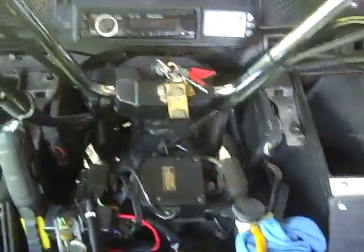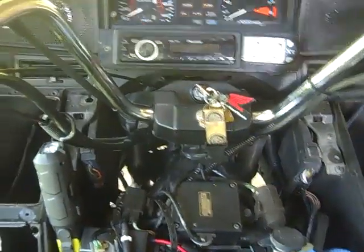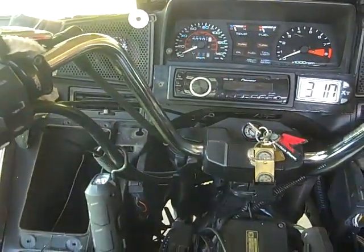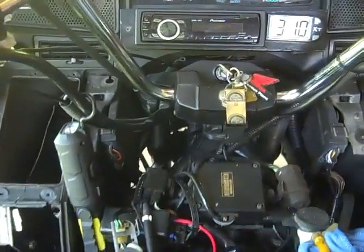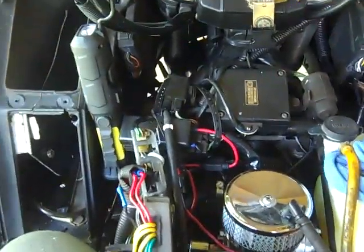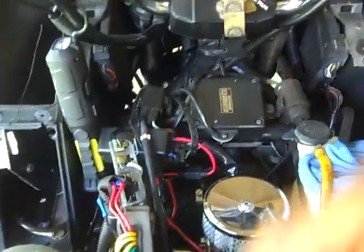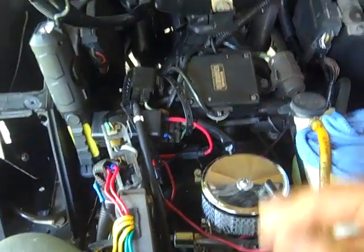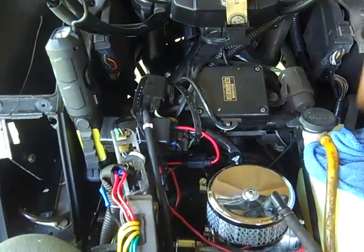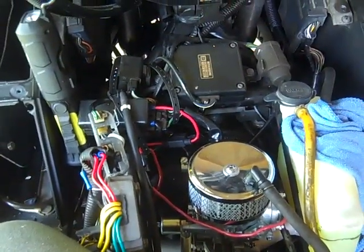Remember, this is how it's running with my motorcycle — with the compression of each cylinder and the mileage I have. I have 50,701 miles on it and other bikes may be different. This is different from running with four carburetors because you can adjust each carburetor for the compression of each cylinder. With one carburetor, maybe that's why it's jumping up and down — one cylinder probably has a little different compression than the other.